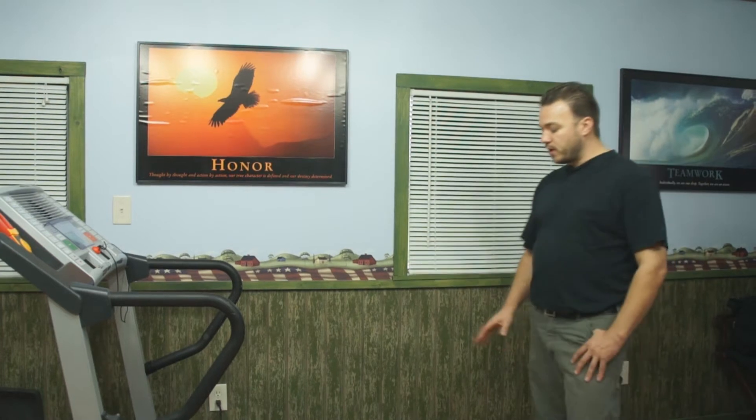In this video we're going to talk about amp draw and how much wear is on your walk belt. The number one thing to look for when working on a treadmill is how many amps it is pulling. When we're on the treadmill using it, the wear on the back of the belt creates a lot of friction and a lot of work for the drive motor and electronics. When that amp draw gets really high, it starts burning out the electronics and damaging the motors. So as a preventive maintenance step, we really want to look and see how worn our belt is getting.